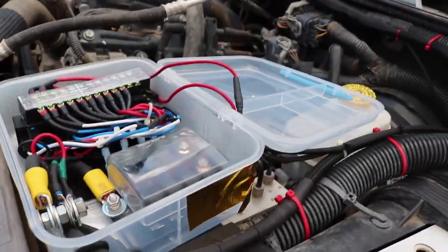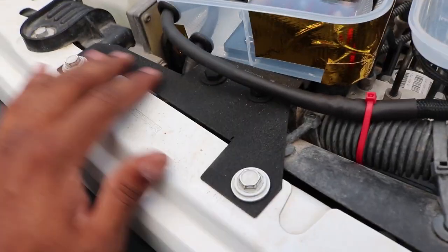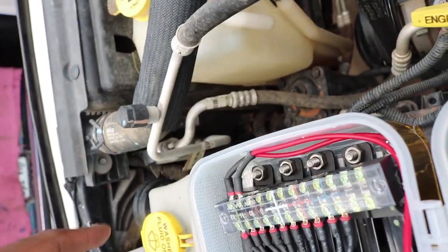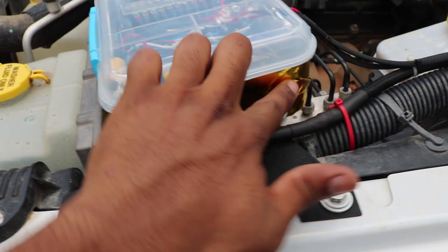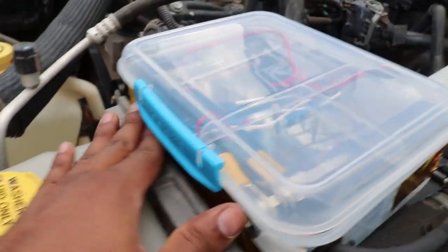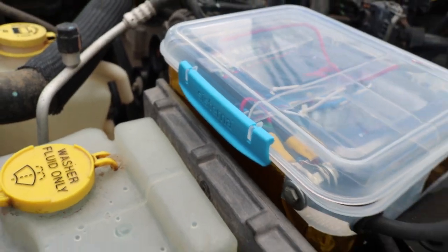As far as this goes, I made a custom mount out of some aluminum or brass — just whatever I had laying around in the shop. It connects to these two parts where the fender is, and there's also a screw that connects to the ECU mount, and I just did it to that. I'm probably going to put some silicone around here so I can get a nice watertight seal. This gold stuff is reflective tape, which is heat reflective. The ECU gets just a little steamy at times, so I might have to adjust this — as you guys can see it kind of pokes into the ECU area, and I can dial it so it's parallel. But for now I'm just going to run it — it doesn't seem like we're having any problems, so it should be fine.